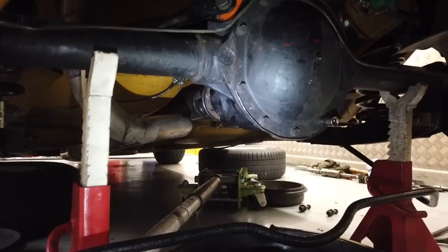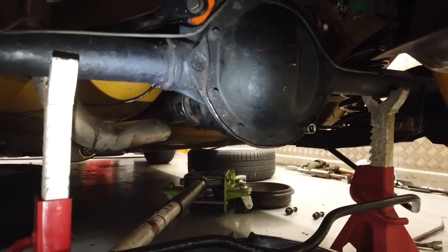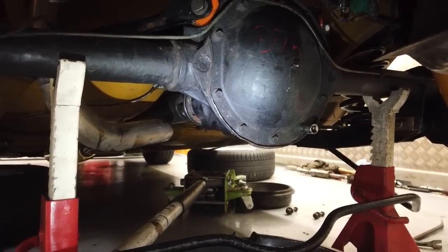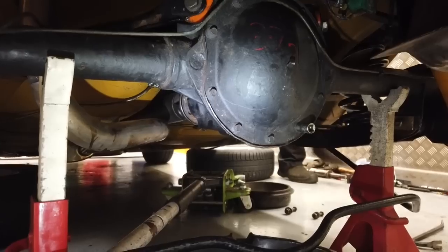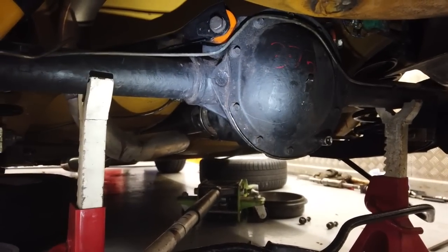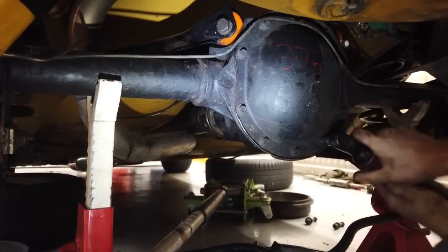Oh, are we on miniature? No, I'll just get the ratchet down on the gun, get in between the tank. So, as I said last night, well, it was last night for you, it's the same few minutes of film. Yeah, it's noisy as hell, and with the stethoscope, the noise was coming primarily from the pinion end. So, makes life tricky because we don't think we'll be able to set up this. We're into territory of axle building.